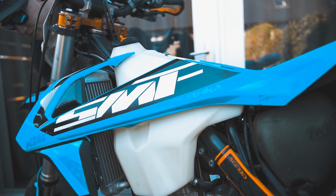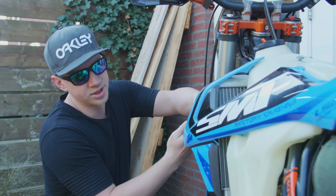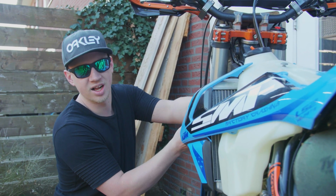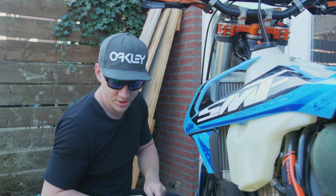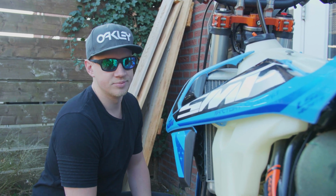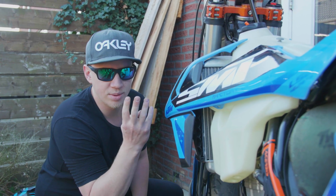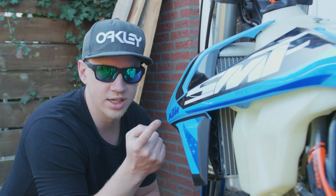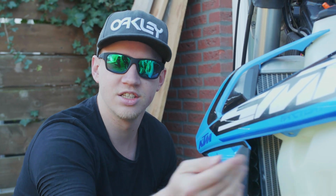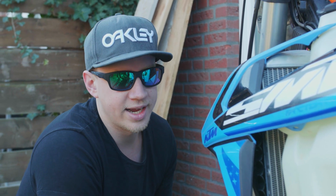Also a lot of questions on Instagram about my fuel tank, because I used to have the carbon tank on it, but I got a leak on it because I crashed really hard in Italy last year, as you just saw before. So I had to mount the EXC tank, which I really hate the look of. But there are 3 options to do. You can get carbon covers for the EXC tank. You can find them at DWS Decals, link below. Or you can get the SXF tank, which is the black tank, and you can mount a fuel pump of the EXC in it.